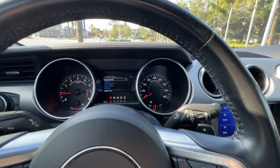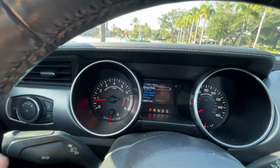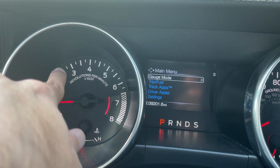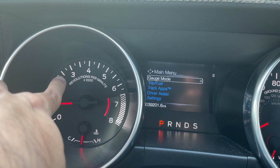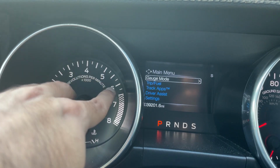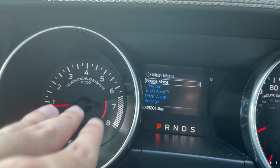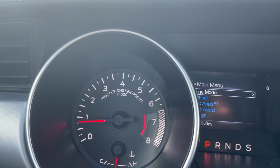Now let's talk about downshifting. Like we said, downshifting shoots up your RPM, so you want to make sure that your downshifting is not going to cause you to pass the red line. So for downshifting, let's use the 3,000 benchmark as well. A little bit less because I want to make sure you don't overshoot where your RPMs are like 6,000 or so. But 3,000 downshifting should get you about 3,500 depending on the gear. Could be 4,000. So I think 3,000 RPM should be pretty decent in terms of downshifting.